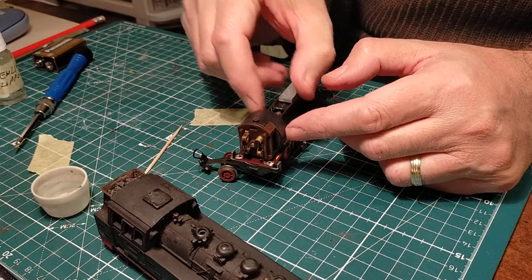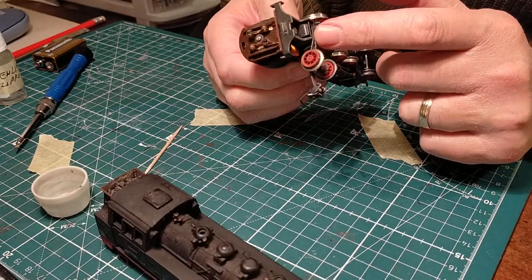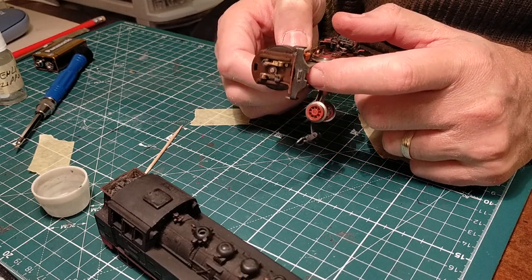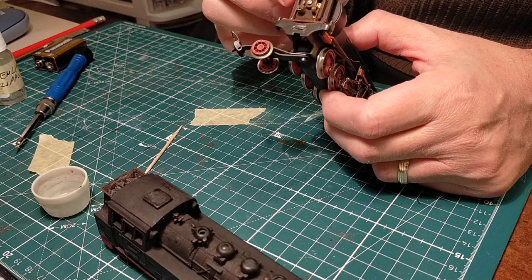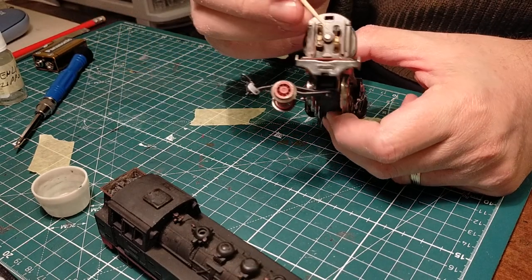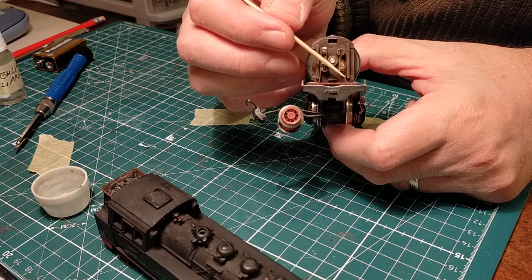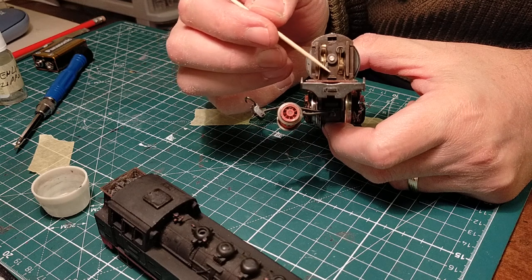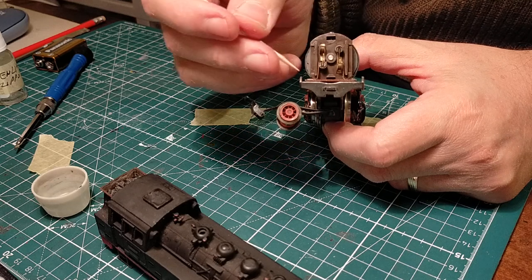The motor is held in position by... there's a screw up here. And I can't... The screw under there. I have to open that. Yes, that's the one I have to open to release the motor. And the motor is not connected by cables. There are no cables that connect the motor. This is an insulated Bakelite plate that holds all the contacts. And here there are two spring-loaded copper brackets.